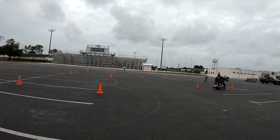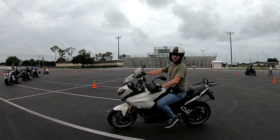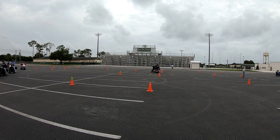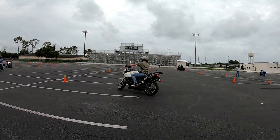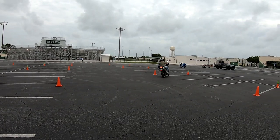Hold up. I know that some people advise that, but you're wearing out the clutch unnecessarily, and of course you're heating up the brake. If you continue to heat them up, you're going to wear out the brake pads and possibly warp the rotor, and that's both big expenses.